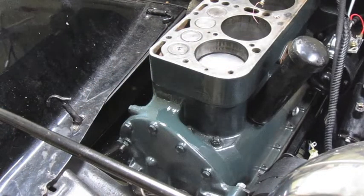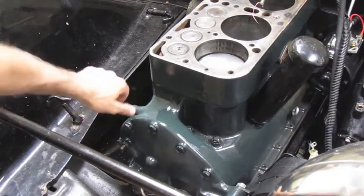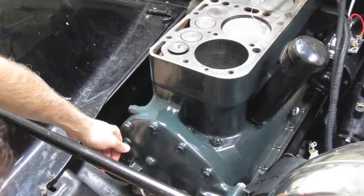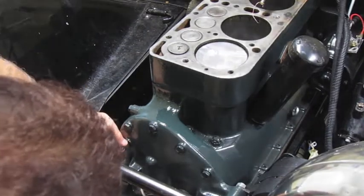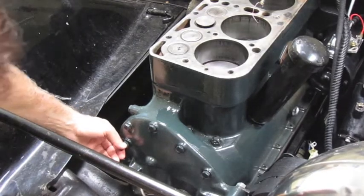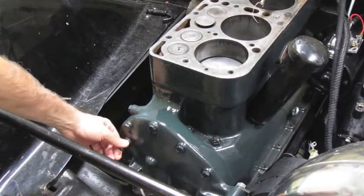The way you do this is: one hand is turning the crank down here, and the other hand is holding this pin in. You don't have to press really hard — just slight pressure. This is the compression stroke, so the timing pin won't go in yet. As you come up on top dead center for the compression stroke, you turn slowly and hold the pin in just a little — not too tight, just enough to push against the timing gear.